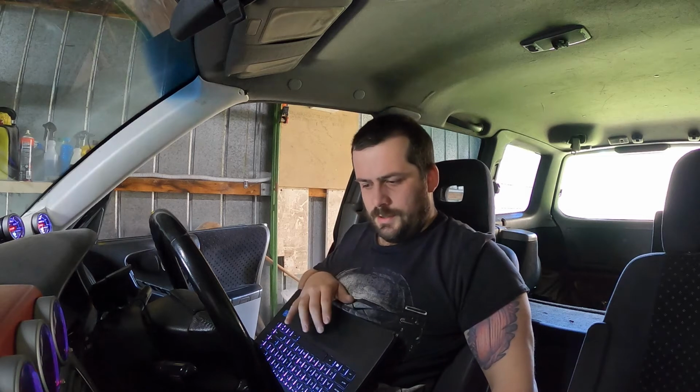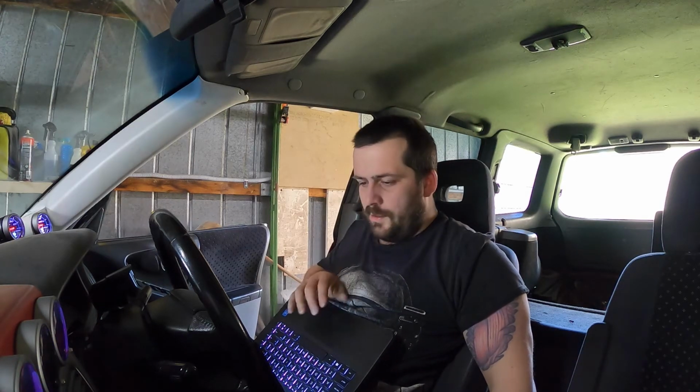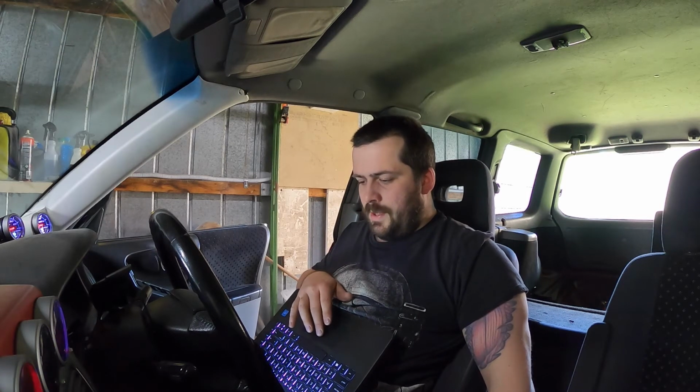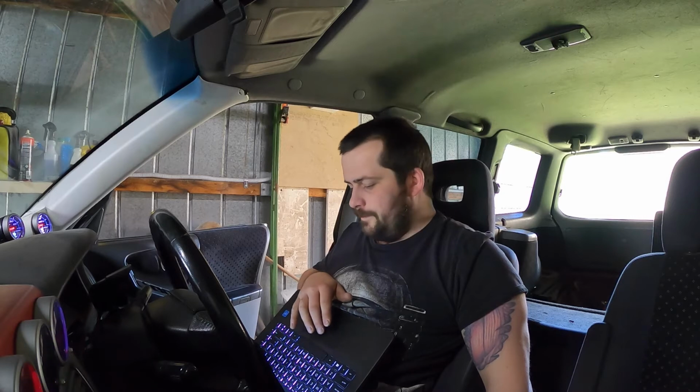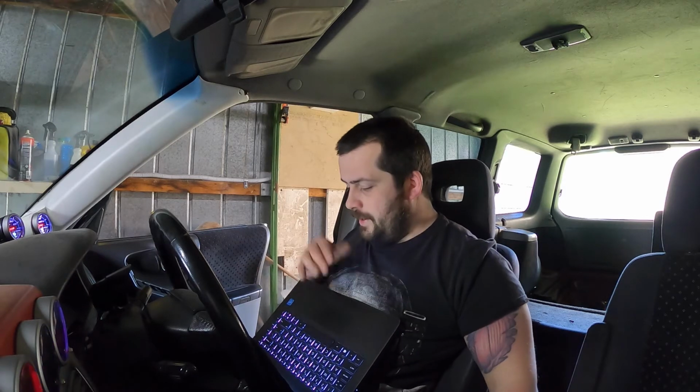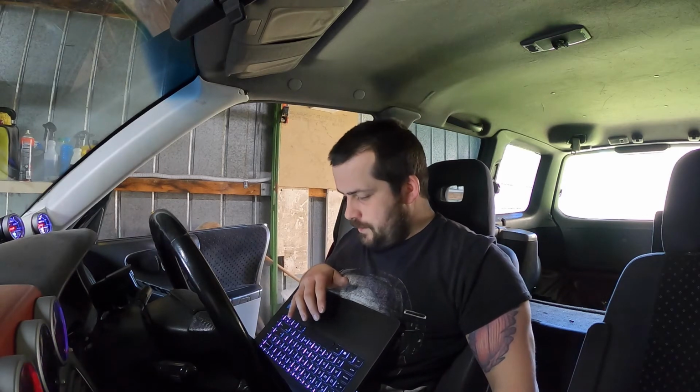I just changed the select logging protocol option. It was SSM and it's K-line. That's what it was on before. But I just clicked around and went back on that and it recognized the ECU.